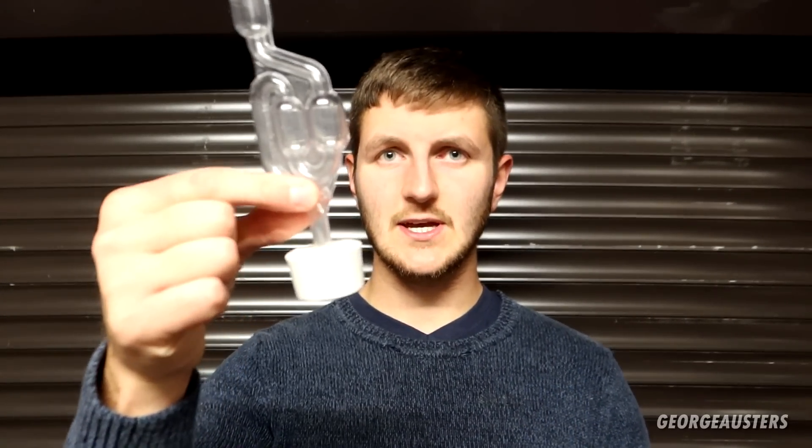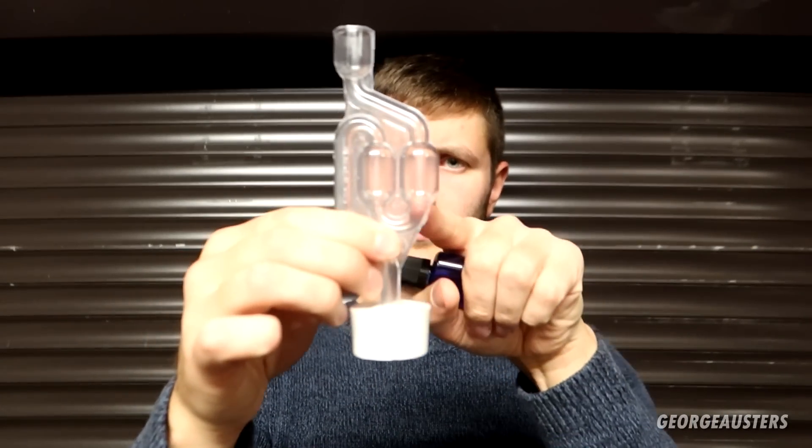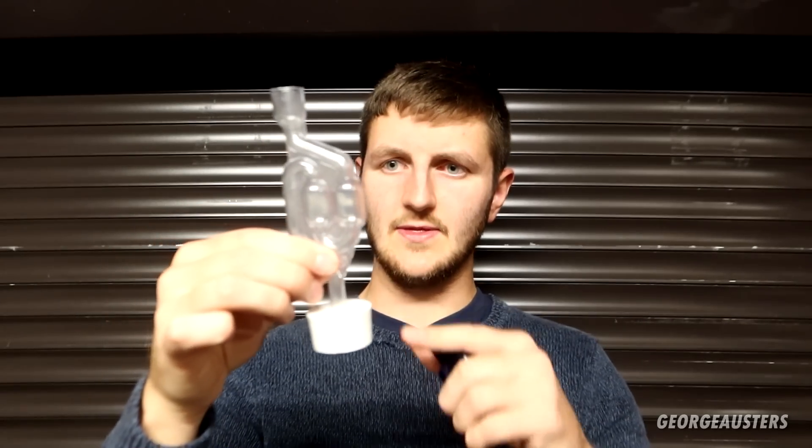Hello guys, welcome back to another video. We are going to be back working on the cheap BMW E93 series and hopefully today determine whether or not the car has a head gasket failure. I did order a head gasket exhaust leak kit — it's just a cheap tube where you pour some fluid in, it sits at a level, then you put it in the expansion tank. If there is CO2 in the coolant, this blue fluid should turn yellow.